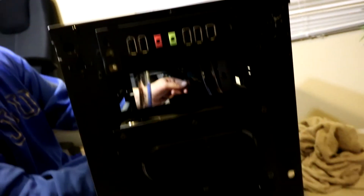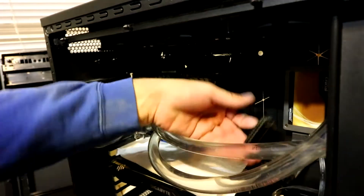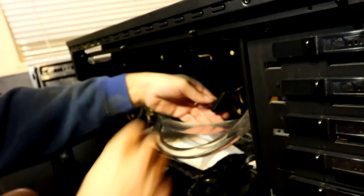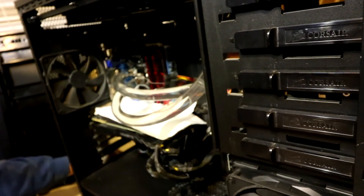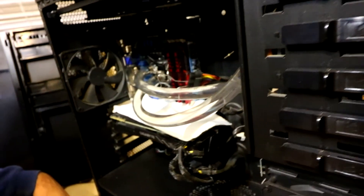Make sure you get a funnel to fill it in — a little funnel to go in there like that. One is for air to bleed it; I already bled it. Let's do another test. Green to black — it has auxiliary power to power on the pump. Green to black, and now to test the pump, make sure it's not leaking. Plug it in and see the water flowing.